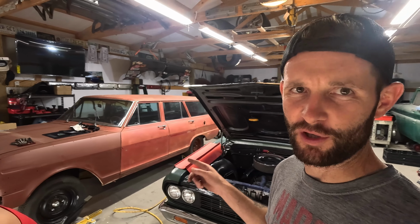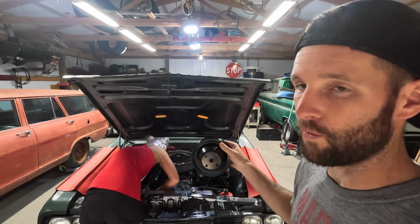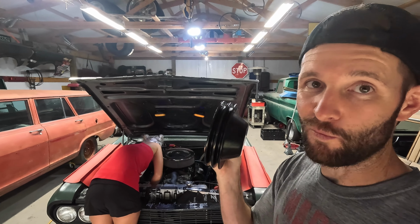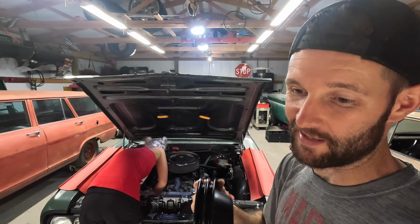All right, we're gonna put the alternator back in on its bracket, and then we'll show you what our current belt alignment situation is. Before I even do that, we'll also swap the water pump pulley, because right now there's a single groove on there. So we'll throw the double groove on straight onto the water pump. We'll show you what that alignment looks like. And then we'll get into the hillbilly redneck fix on how we're gonna get the belt alignment corrected.